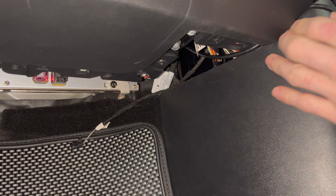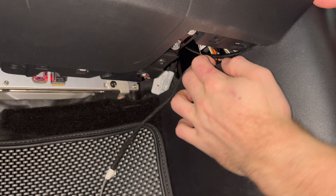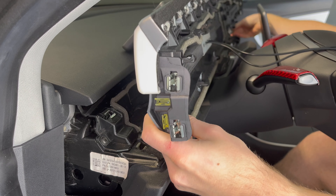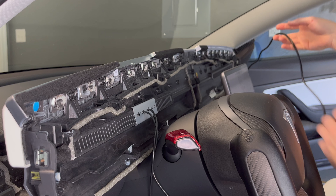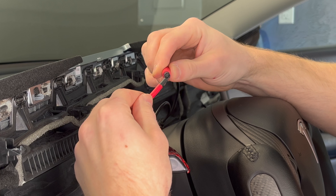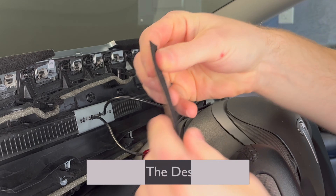After these are installed, we now have to hide the cord from under the glove box by using a pry tool or your fingers. Tuck the cord right above the trim. Remove this side panel and place the cord upward. We can now take our dashboard with the display and place it over the car dash upside down. Take the cords from the screen and the cords from our Tesla and plug them in — red with red and blue with blue. I found it best to use felt tape to attach the cords on the bottom of the dashboard; I'll have a link below this video should you need some.